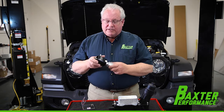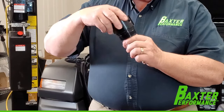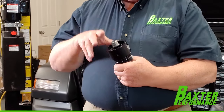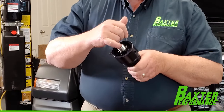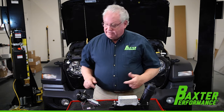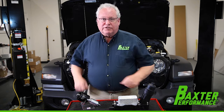So we came up with this — it's Baxter Performance MS-201BK. It has a docking collar that's spring-loaded, internally sealed. It also has a threaded cleat to lock it rotationally to keep it from backing out when you're installing or removing the filter. It also has an air valve that actually purges the oil out of the filter before you remove it, so you don't make a big mess. It also has a check valve, and that's the magic of this piece — because along with the spin-on filter that has an anti-drain back valve and also a check valve on the outflow side, it retains all the oil in the system up on top so it's ready to go as soon as you start your engine.